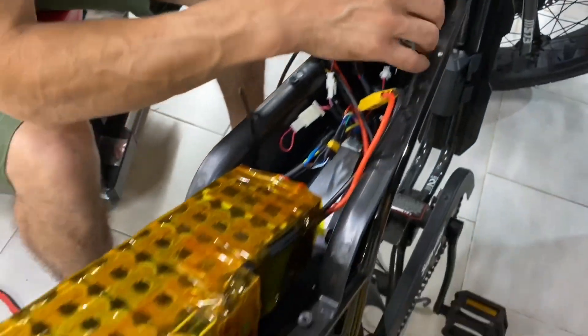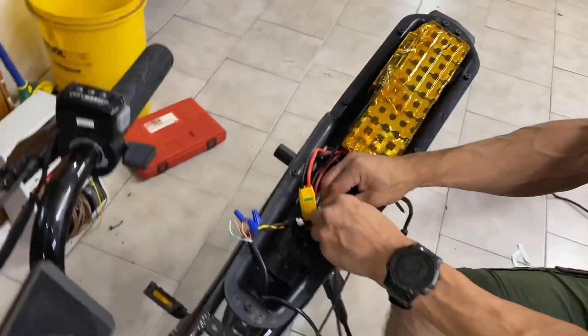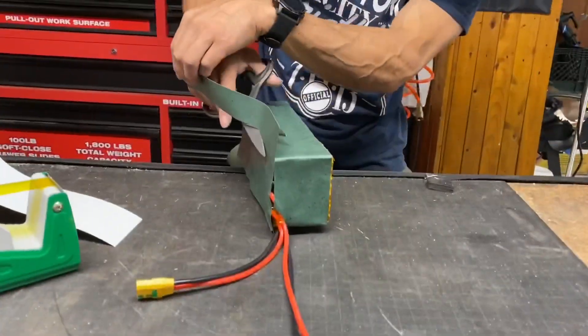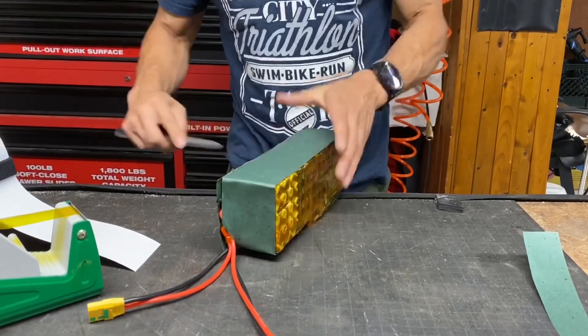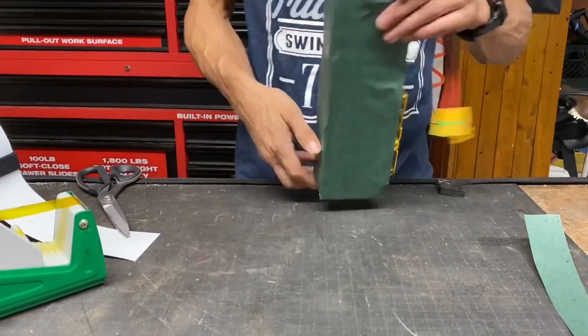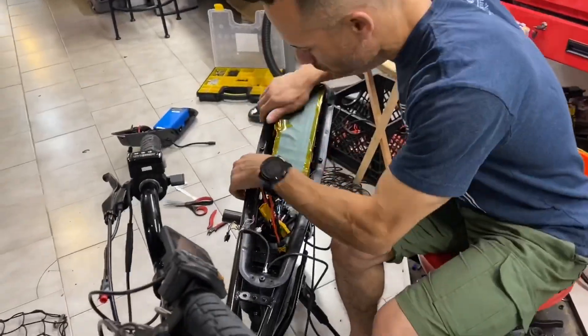In addition to that, you're able to lock down the battery so that nobody can turn the bike on until the battery is unlocked again via the phone app. Next we'll add a layer of fish paper over the battery for additional water resistance and insulation, then finish it off by putting the battery in a heat shrink wrap and shrinking it down to size. But for now, for testing purposes, we'll put it back in the seat.